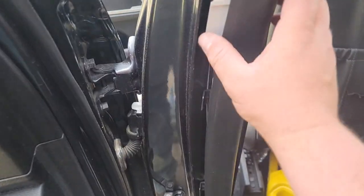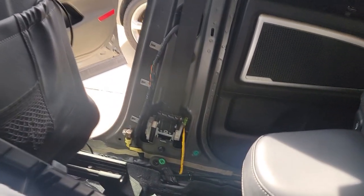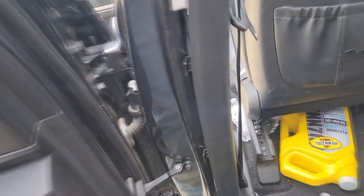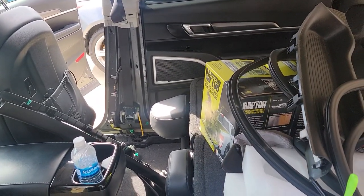I'm not sure on every model, but on this particular one, the way they have the audio set up is on this side — it's yellow and green inside of that wiring harness right there. On the harness over here, it's orange and green. So the orange would be the positive, green would be the negative, and then yellow would be the positive, and green would be the negative. We're going to run it behind here, get that portion done, get it all cleaned back up, and get all the wires run.